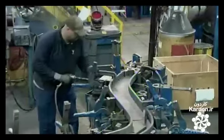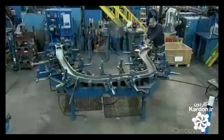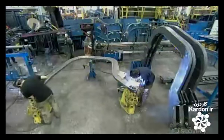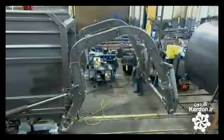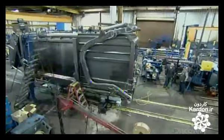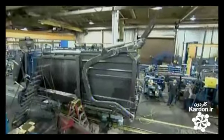Across the factory floor, another team assembles a pair of steel lift arms. These lift arms are designed for another kind of truck — the front end loader. It's mainly used to collect hefty commercial garbage containers. In action, these arms pivot around the truck cab and extend to the front to fork up the trash container and deposit the contents in the hopper. Hydraulic cylinders also power these lift arms. When the task is complete, the forks at the end of the arms fold back out of the way.